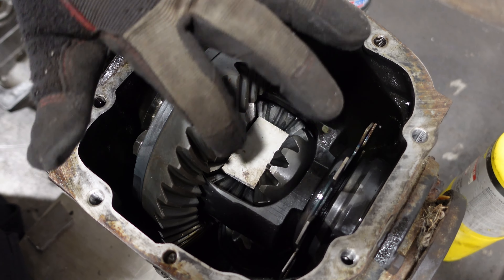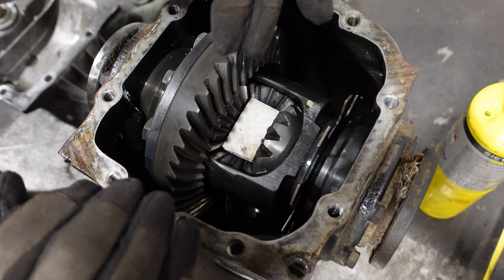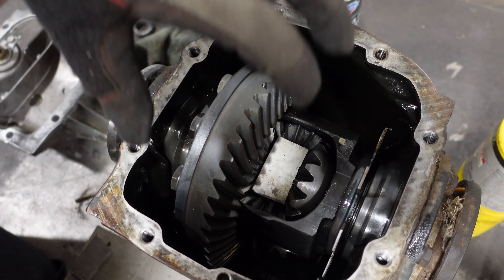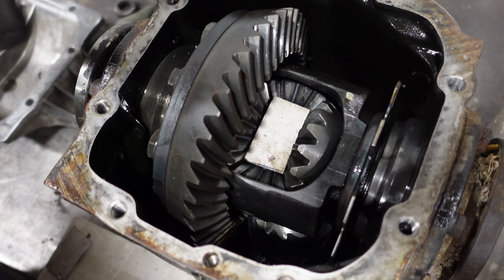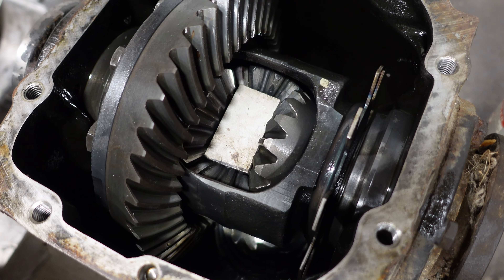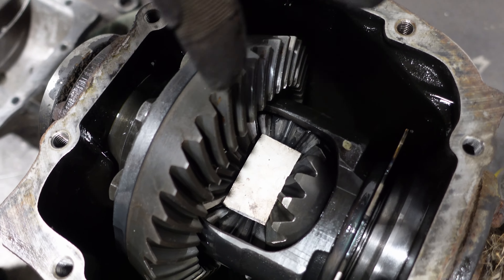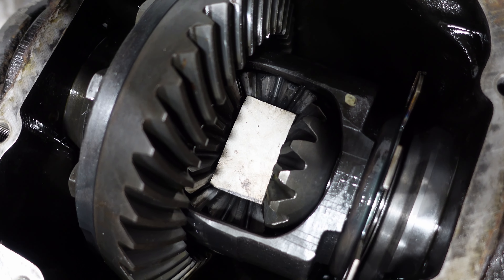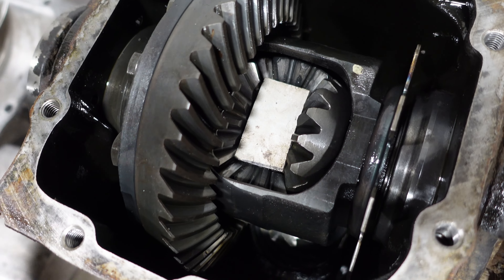As you can see, that plate is in there now. The one thing I always do is cut the plate a little bit long and set it down on top of the two outer spider gears. The reason is you still need room for your axle shafts — if an axle breaks you can still pop it out without it hitting the plate. So you want to set that plate up off the axle stubs a little bit before you weld it in. Now we're going to tack that in and put some heat to it.